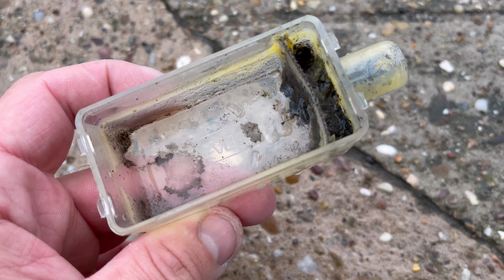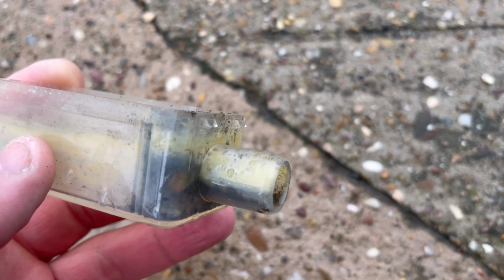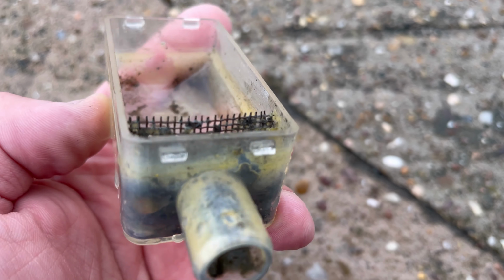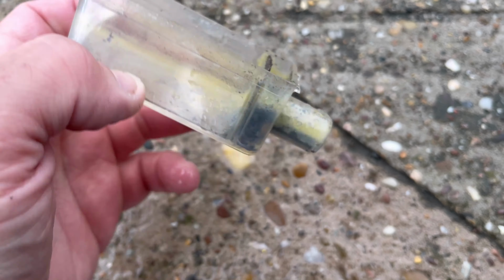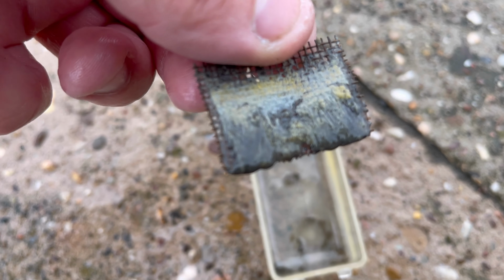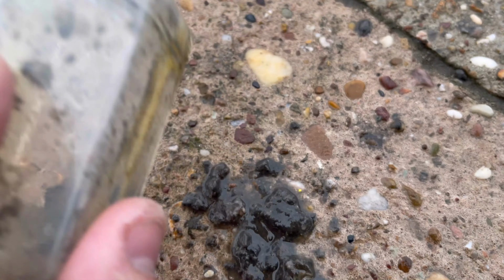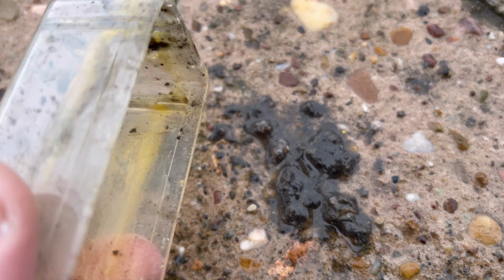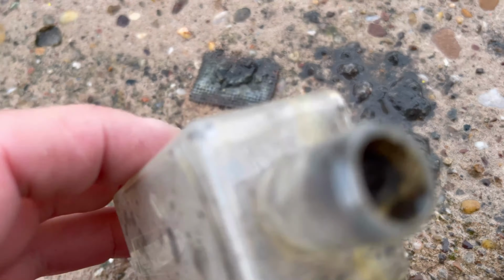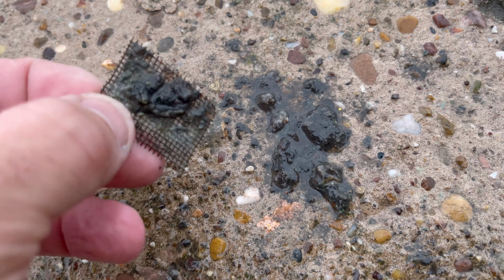And look at that, you'll see there, look, all gummed up inside that gauze, so definitely don't think any water was getting past there, which is probably why the unit was leaking water, but whether the pump still works or not, I don't know, but look at that. Right, let's get some of this crap out of there. There you go, all that gunk. Obviously that little gauze or filter has got blocked, and then all that crap in there looks gathered, so you'll see it on there.